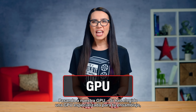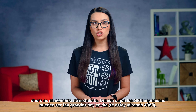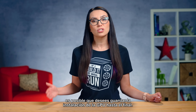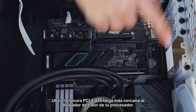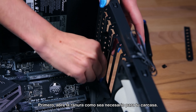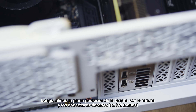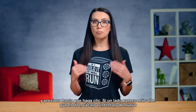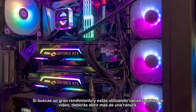Moving on to the GPU. If you've chosen a dedicated GPU for your build, now's the time to install it. Because dedicated GPUs can be so large nowadays, you may wish to save GPU installation until the very end. Locate the long PCIe X16 slot closest to the heatsink of your processor — this will be either the first or second expansion slot on your motherboard. Open the slot as needed for your case, then line up the card's back plate with the slot and gold connectors and push it until it clicks. If one side looks higher than the other, pull it out and try again. If you're using multiple video cards, you'll need to open more than one slot.